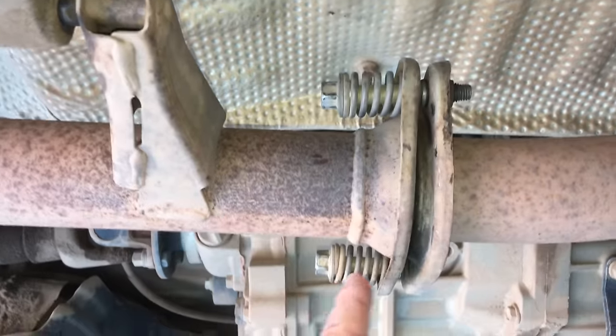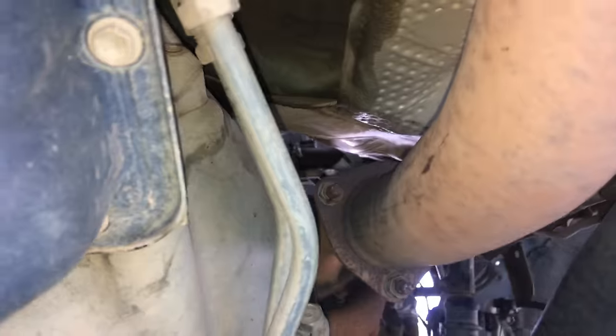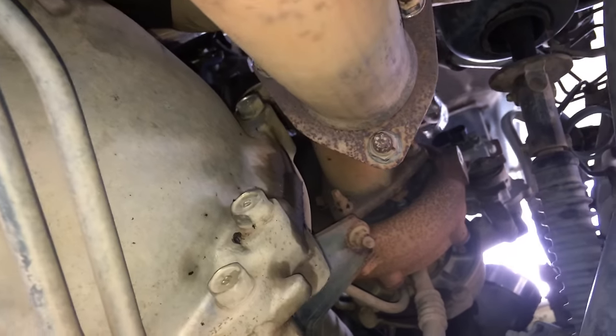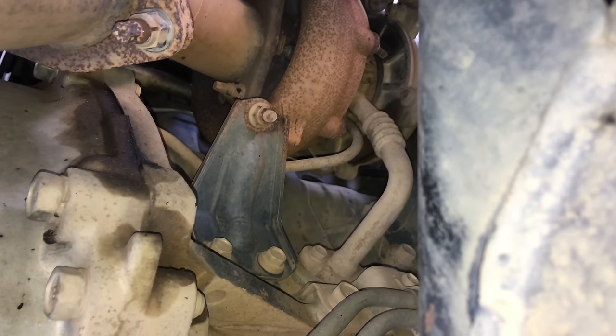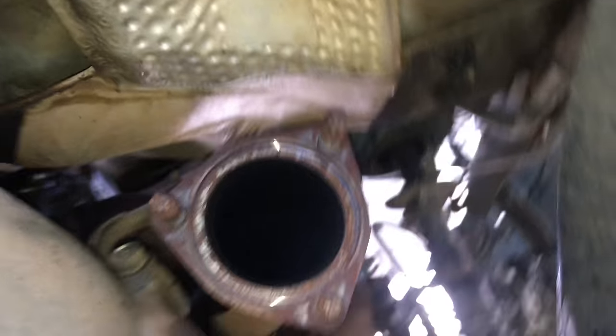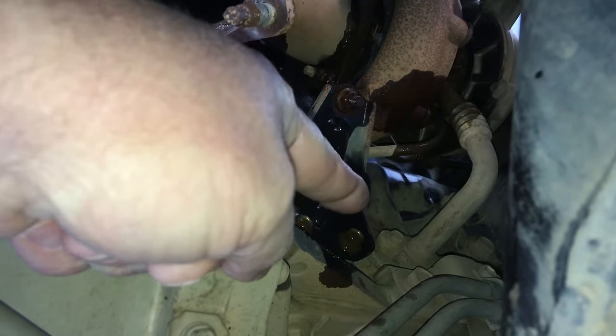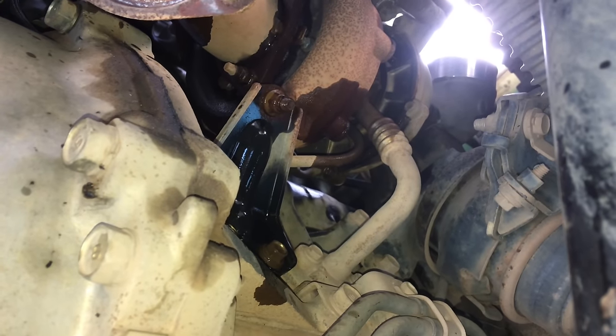With the vehicle raised on the hoist, we're coming underneath to take out two bolts. That's the squeaky exhaust gasket area — good time to change that as well if you're changing your turbo. Following it up, there are three more bolts to get off. On the back of the turbo there are three more bolts, and we'll need to remove the bracket at the bottom which has two bolts and a nut. That's also where the oil return goes back to the block.